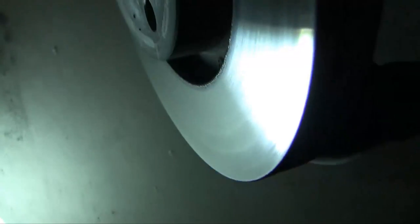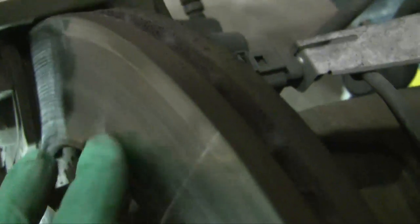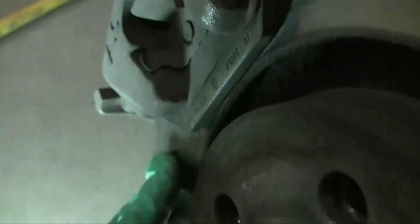I want you to look at this rotor. This rotor is perfectly smooth — we have no divoting or ridging. I've had no trouble with the brakes pulsating or pounding. I'll have a look at the other side of the rotor, but I'm going to retain this rotor without either resurfacing or replacing it because I think it's good.